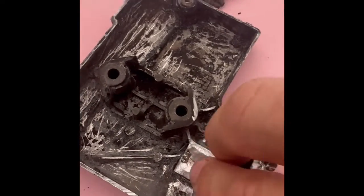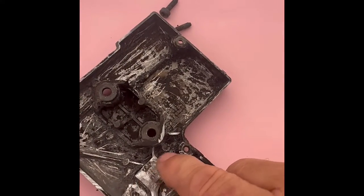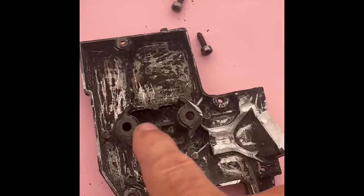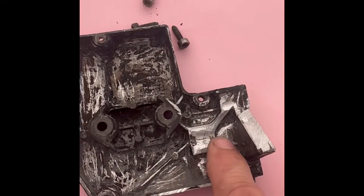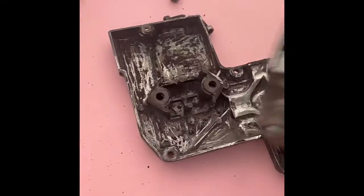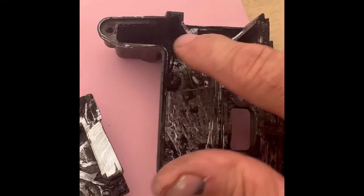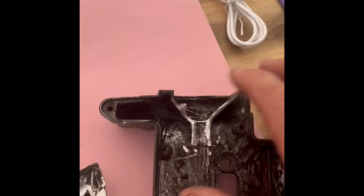You've got to be really careful if you're doing this, because underneath there, you see that die cast comes up there. So if you do that too flat, you'll break through and you're in all sorts of trouble. So basically, I've ground that right out, so all the air can come from this side through here, over the top and over the top. Of course, it's going to still hit that, but I've then put this in the top side. Well, I've put a big mouse hole there and there, so air can come around that side and through, and that side and through. Now, obviously, I haven't made it too big.